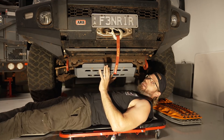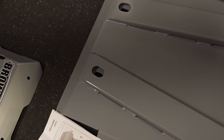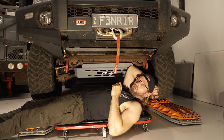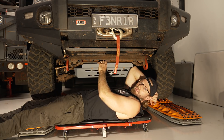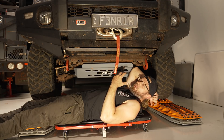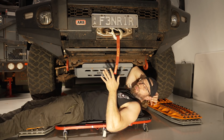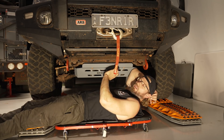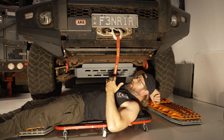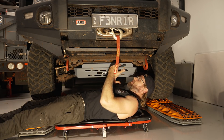It's in four parts. Three of the big pieces cover the main part of the vehicle from the sump back to the gearbox. The fourth part covers the transfer case and some vital components. The factory plates will offer some decent protection, but the metal isn't as thick as these. If you want to go on hard stuff where you may slip off a rock and land on a boulder, this gives you more confidence to drive harder terrain.